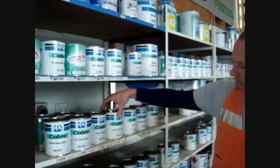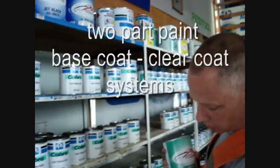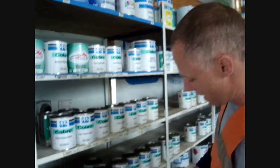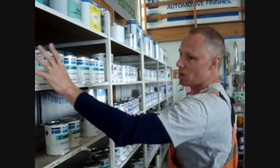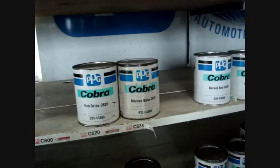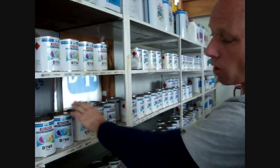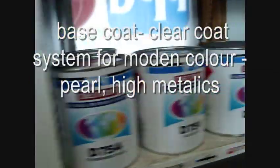2K Cobra with its hardener. This system here is your Cobra system. These are all your bases for your Cobra colors, so you mix up your Cobra base colors. That goes on your 2K primer or your 1K primer. This is all your metallics, and then they get the clear coats over the top — 2K clear. So that's your base coats, 2K base. These are all your base coats or base colors that get a clear coat over the top. This is the Deltron system — this is the newer range, also 2K clear coat over a base. These are all your late model base colors. So that's what's all available to use — you can choose what's on your car or what you're going to respray your whole car in, and all of these systems are still available in color matches or whatever color.